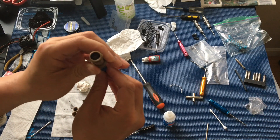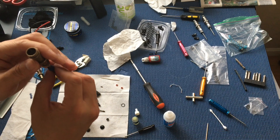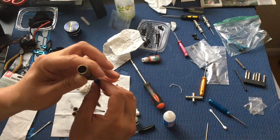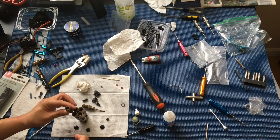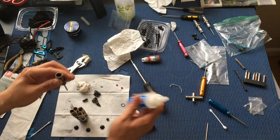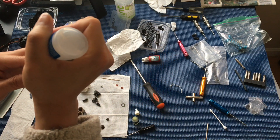You don't want any air bubbles in there, because air bubbles will compress whereas fluids are not compressible — gases are. So any air bubbles will compress, leading to inconsistent shock properties. Make sure to get any air bubbles out.